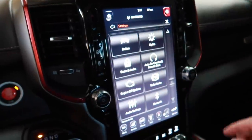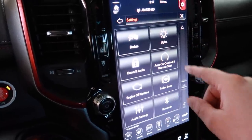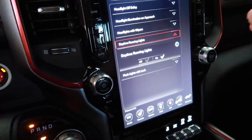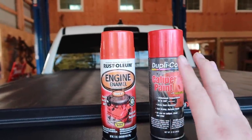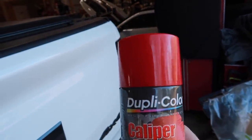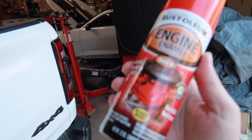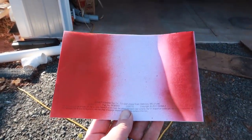For anybody wondering how I got the amber lights to be the daytime running lights — you can do that without the Taser, right in your menu. Go into Lights, go to Daytime Running Lights, and turn them on or off. When they're on you'll get the amber; when they're off you'll just get the halos around the outside of the light. Now I have a couple different shades of red and I want to do some samples to make sure they're as close to the stars as possible. I have some Dupli-Color caliper paint which is more of a darker red, and some engine enamel which is a bit lighter, almost closer to orange. I'm going to spray both on white paper to see what the color actually looks like.